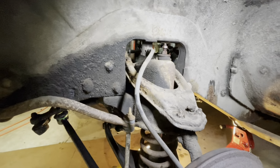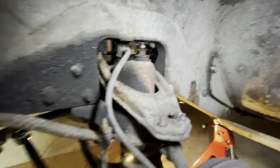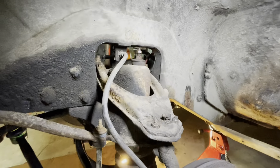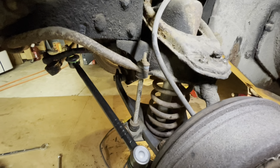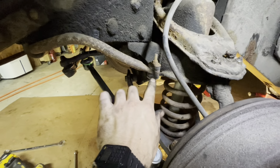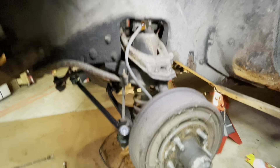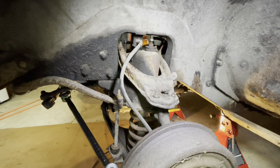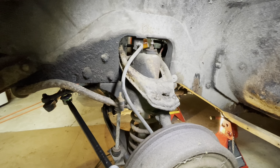Alright, well that's one side done — as done as it's going to get anyway for Mountain Meat. Obviously my double-nut situation here is not great, but when I do the disc brake conversion that's just going to get cut off. New tie rod, new bushings — the shocks are soft but they're okay, they're not leaking or anything. New bushings on the sway bar ends here as well.